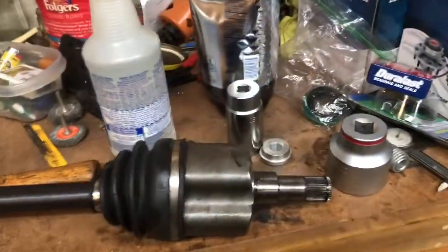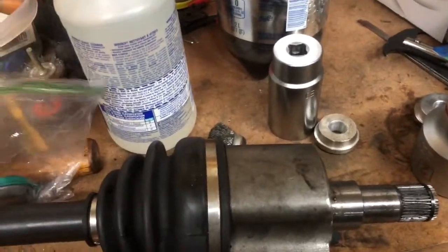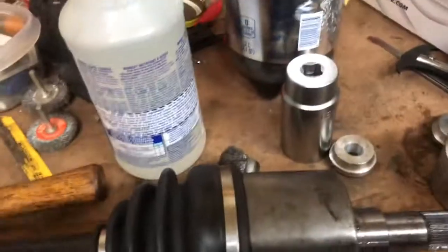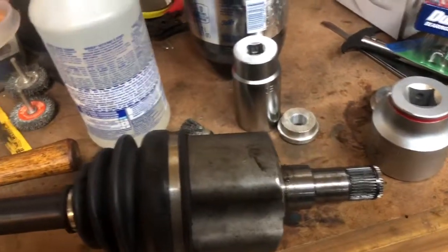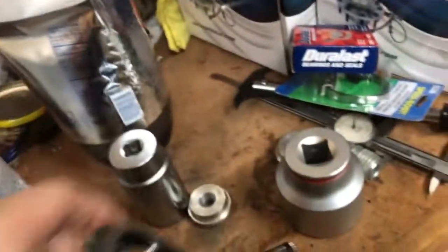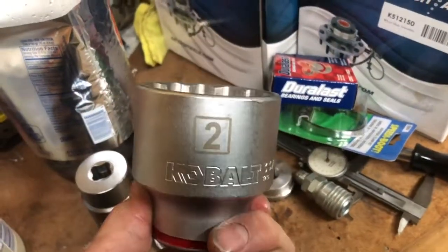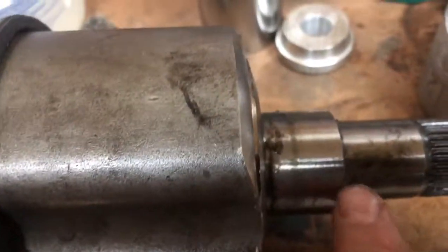The plan for today is to investigate why this axle and seal won't seat and seal properly. This is the seal I tried to put in — you can see the rubber's in good shape but I kind of crushed the outside of it, so we're not going to use that one. I've got another seal from Duralast and now I've got a two-inch socket to use as a seal driver. The big thing is: why isn't this sealing? The seal looks like it's riding right about here — I don't know that that's quite enough — and why isn't this axle going in far enough?